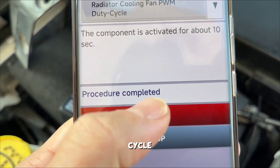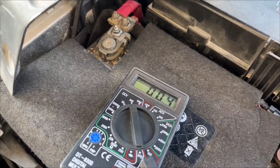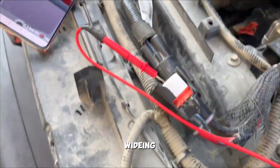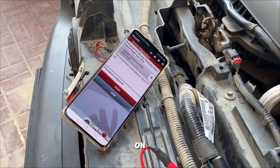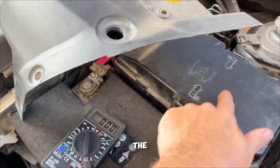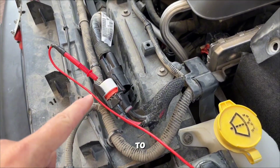You can hear the fuse box clicking and you can see the power going. So you can assume that the connection between the fuse box and the wiring is okay because it's sending power based on the commands sent. I have tested that the connection between the fuse box and the wiring seems to be okay — the power is being sent to the blue wire which triggers the pulse to start the fans.